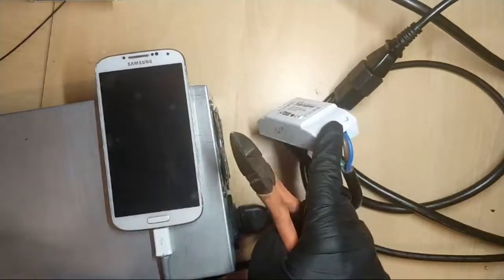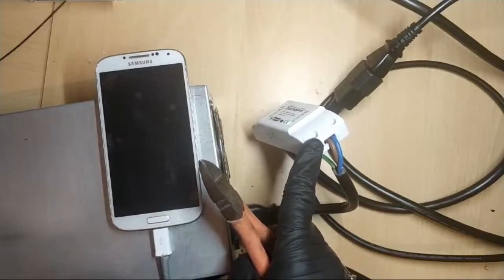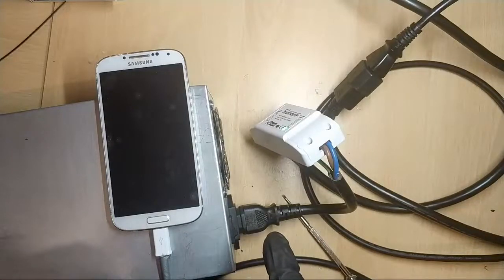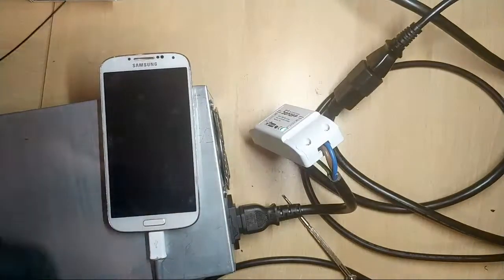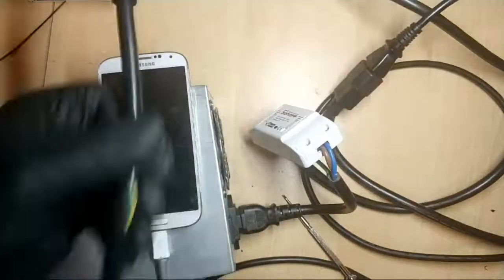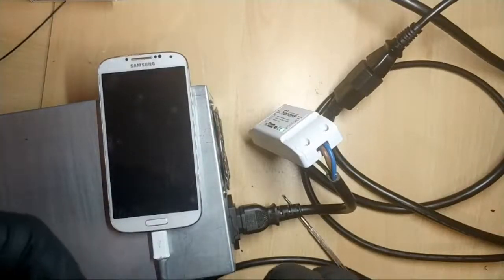It must create its own SSID, unless you can actually send data to other Wi-Fi network connections without actually logging on to it. Hackers use that. If I had a computer, I could send a deauthentication message to that network, that SSID, and they'll knock off every single device off that network without me actually being connected to it. Because not all data on Wi-Fi is encrypted. The handshaking part isn't, and that's the downside to WPA2. And then what you do, you tell the clients to re-authenticate, but to an evil computer. So it could be using something similar to that. I'd have to use Wireshark and sniff the packets to see how it actually works.